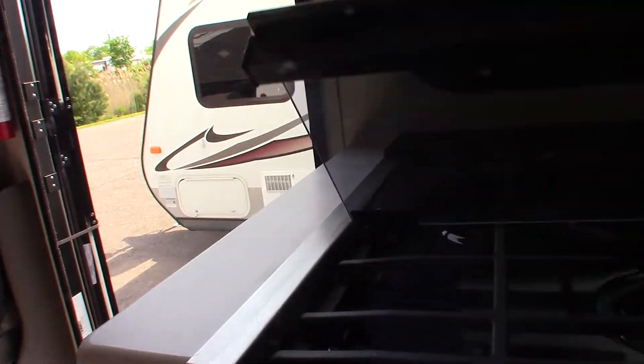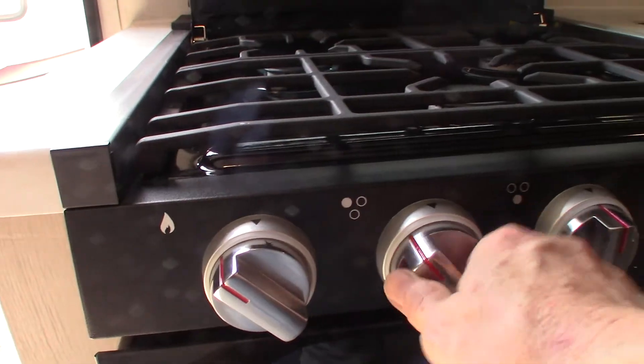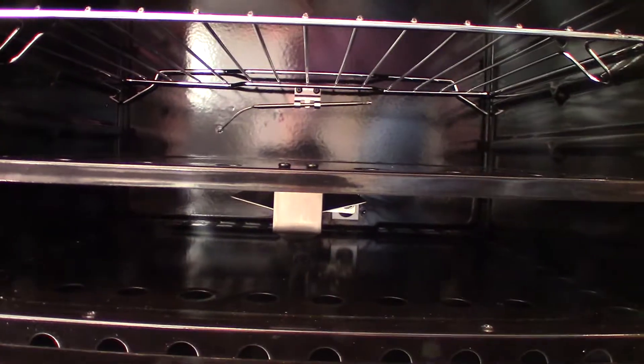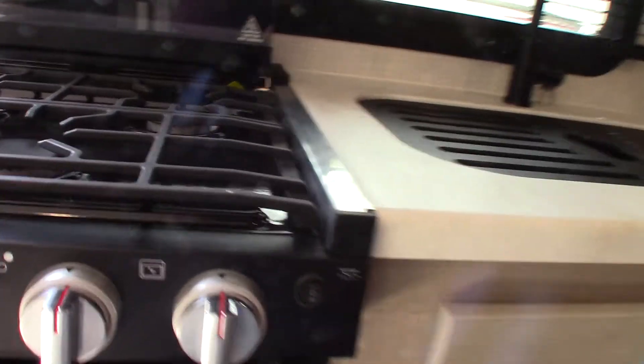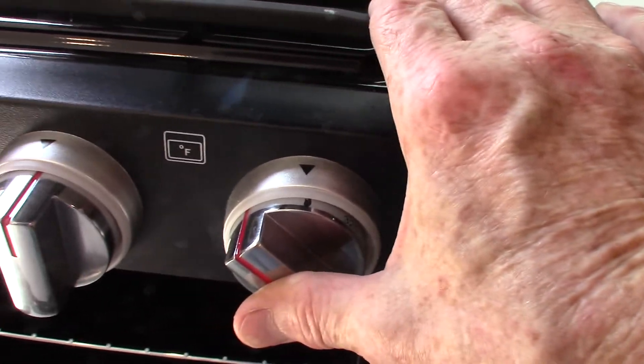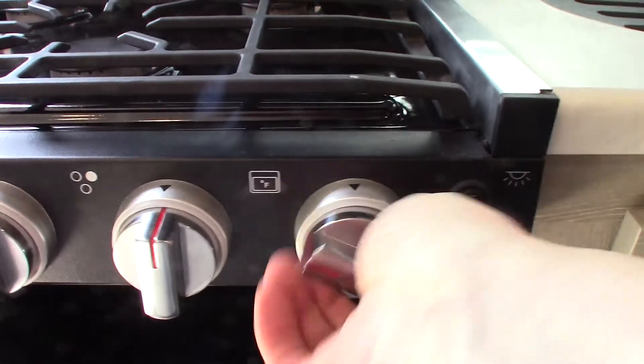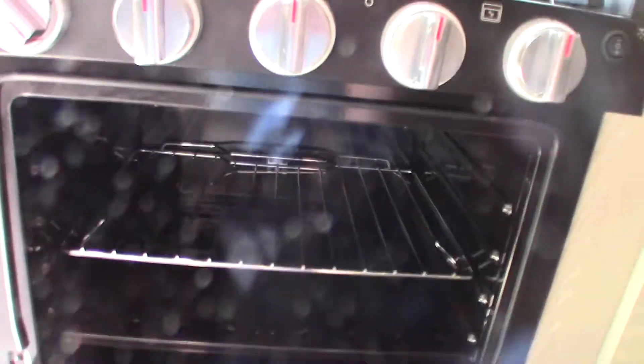This is the range hood — remember about opening the baffle on the outside. Your range itself: this is the sparker, you turn it clockwise to spark. The oven is a little different — it's got a pilot light all the way at the bottom in the back. You go to the oven knob, which is the farthest right knob, go to the flame position, depress and hold it in, then spark with the other hand until it lights. After it lights, still hold it in for another ten seconds or so to heat up, then go to operating temperature — it cycles. When you shut it off the flame goes out, and so does the pilot light, so you have to relight the pilot light each time you use the oven.